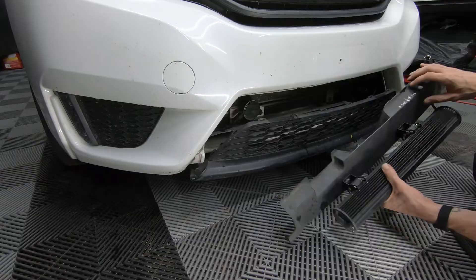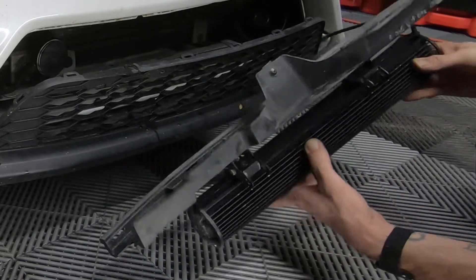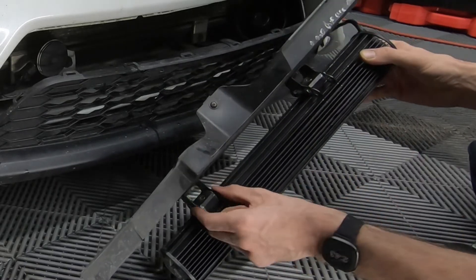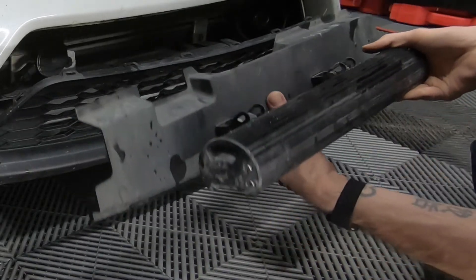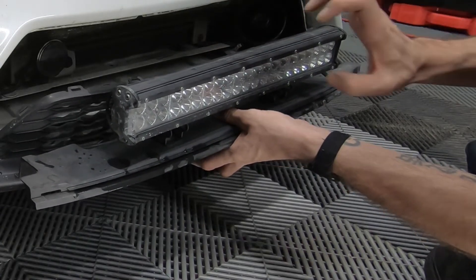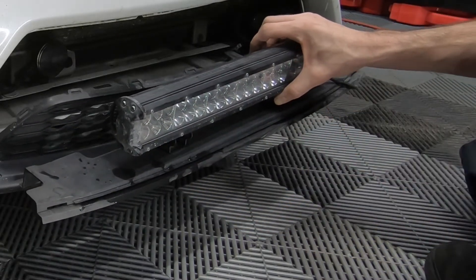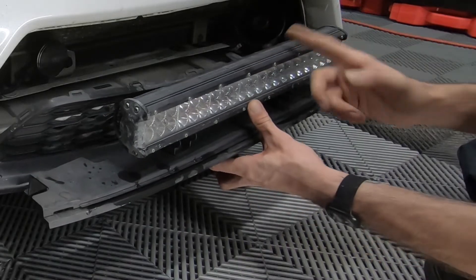You're just going to have this plastic piece. I used the stock mounting hardware it came with — two bolts, drilled two holes through the plastic, put the nuts on the back. I would probably get some stainless steel hardware if you can. This is the cradle mount I'm talking about — it tends to vibrate loose. As you can see, there's one of four bolts in here; this one still has all four. That makes the light bar kind of tilt back and forth while driving. Other than that, it stays solid just on the plastic itself. That is why I zip tied it on the front, to prevent it sliding back and forth in the cradle mounts. Some other light bars mount on the side with Allen bolts — those might be better, but for the price, I couldn't beat this one.